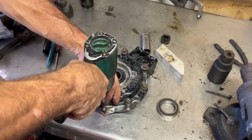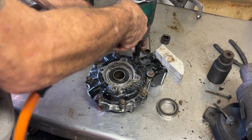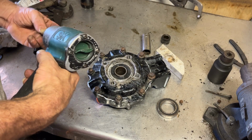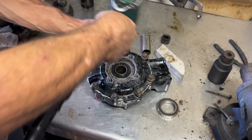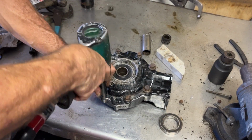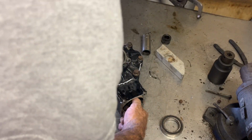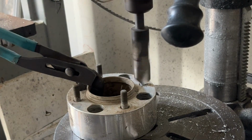I ended up using a piece of 1-inch round bar in one of the gaps, and I welded the snot out of it, and it made it so much more stiff. Got rid of the flex for the rear shock. He should be good to go. I'm not really worried about him cracking or breaking that plate again. Little worried about the arms on the swing arm breaking now. Also had to fill in some rot spots and some weak spots that were letting water through.